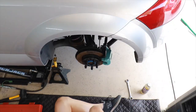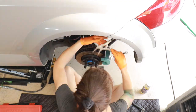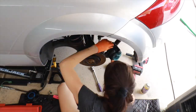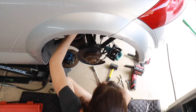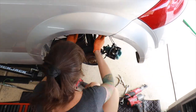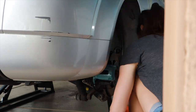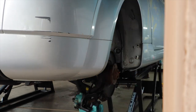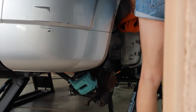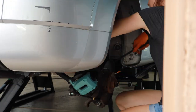As far as my rear end went, that was a little bit trickier. Everything came apart brake-wise fairly easy but what became difficult was when I had to move on to the suspension. The rear struts unbolt with a nut on the top and on the bottom. However, when it came to the springs and removing them from the spring perch, I had to jack the car up with a floor jack off of the quick jacks because the rear trailing arm was pinched between the car and the quick jack assembly.